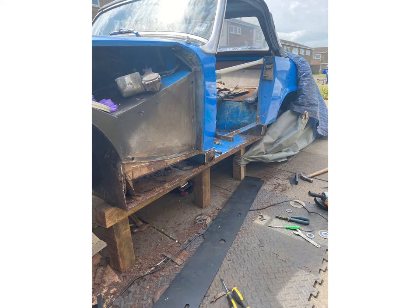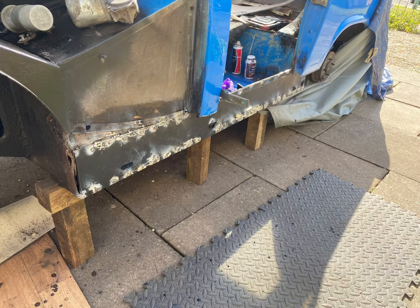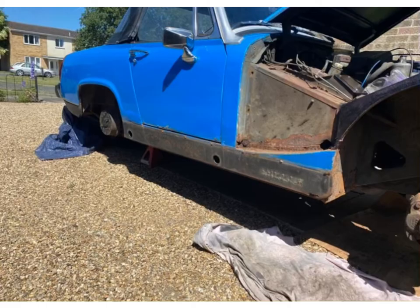We kept the bit on the bottom of the door to reinforce it and then welded the inner sill on. On the driver side the inner sill was quite solid. We think both sills had been replaced in the past, but they weren't coated with rust wax, so after about 10 years they were just as bad as before. We've done it properly this time and coated it with rust wax inside and out, so hopefully it prevents rust in the future.